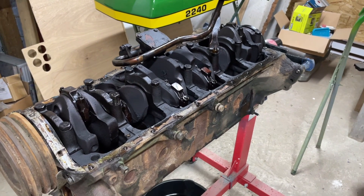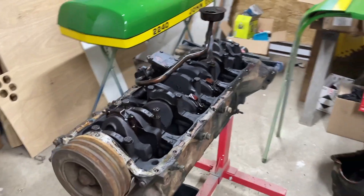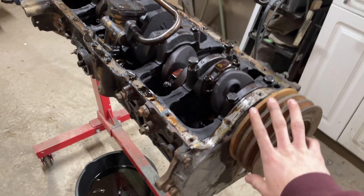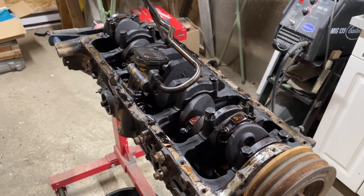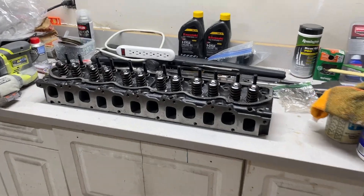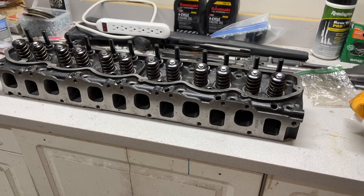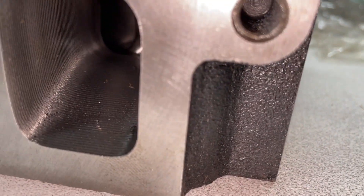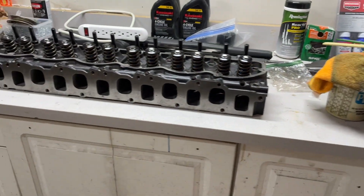The goal is 500 horsepower, and it's doable. I'm sure you guys have all seen the Power Nation videos — I think I can duplicate it pretty easily. Probably going to have to have a custom grind cam, which brings me to my next point. Going to need a good cylinder head, which is exactly what's sitting right here. Some of you guys are probably thinking that just looks like a stock 300 cylinder head, but it is CNC ported.